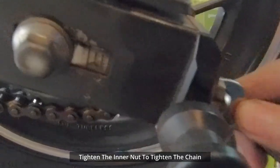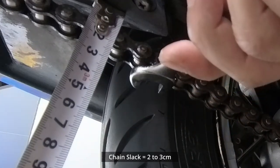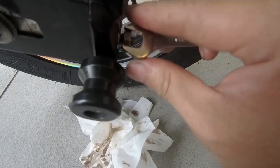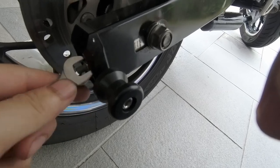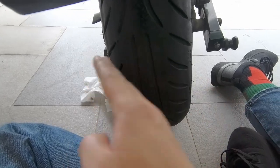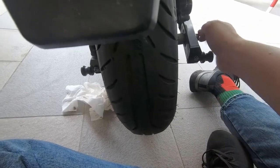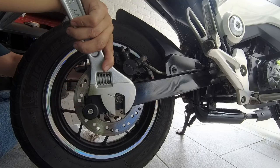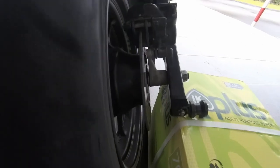Okay, so now it's on the one, two, three, four marking. Push it forward, so now we measure this. We move up, then just lock the second nut to dial in the setting. We repeat this on the other side. We inspect if both sides are aligned — okay, more or less. Once it's done you just need to lock back the nut. We spin the wheel and check if the rotor is straight, and inspect the chain is aligned.